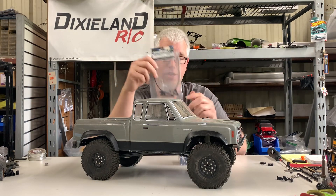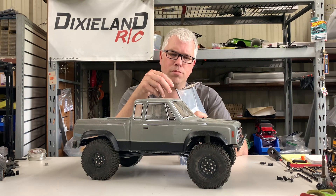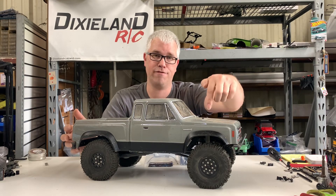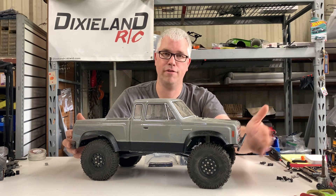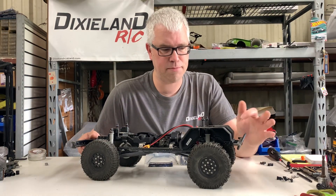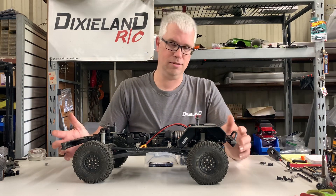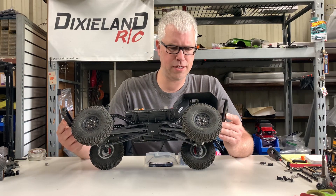It's made specifically for this winch. I've tested this to make sure it's going to work before making the video. This particular truck has a fair lead hole already made into the front mount area, and the bumper mount itself has a fair lead hole in it. We're going to utilize that to keep the line from getting crossed up and tangled. The way I've done this is a little bit different than how I would normally set up one of these.